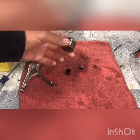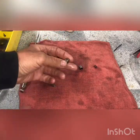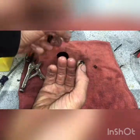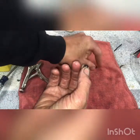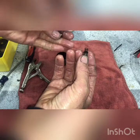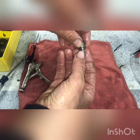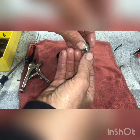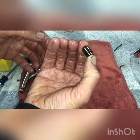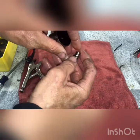Now when we're going back together — you've got your lifter, this is the end that is sticking out. Here's our little plunger; see the little tip. The spring is going to go onto that, and then that is going to go into the plunger like this. Just kind of work it until it slides in there, and it should spring-load itself like that.